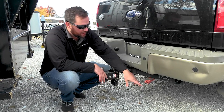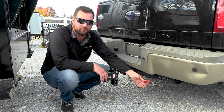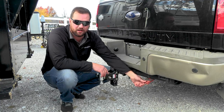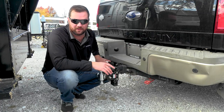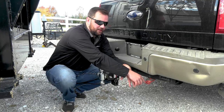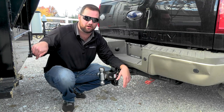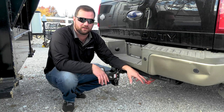The second way is going to be an Anderson style plug, and you may have seen it on plow trucks or work trucks that need a higher power output at either the rear or front of their vehicle. The plugs usually look like this — they'll have a red end to it. Basically it's just an improved version of the seven-way plug itself. The improvement is that it uses a much larger gauge wire, usually about 2-gauge or 0-gauge wire, and it runs from the battery on your vehicle back to the rear of the vehicle, where you connect it to the battery on your dump trailer.